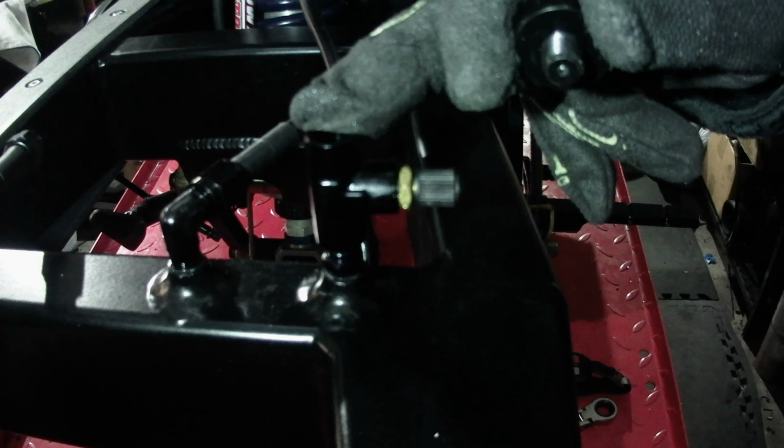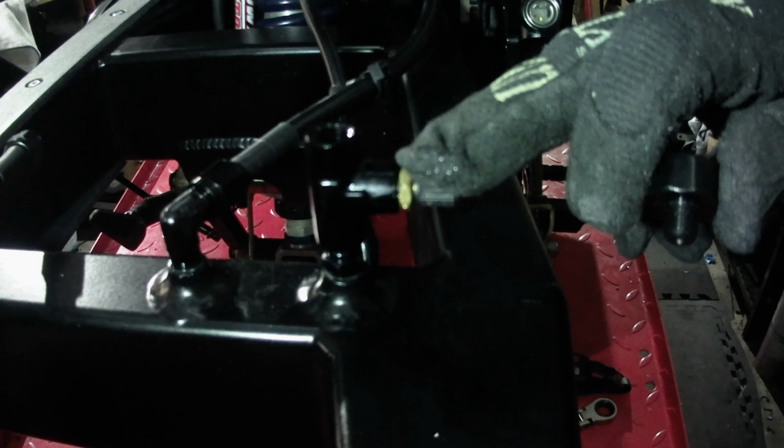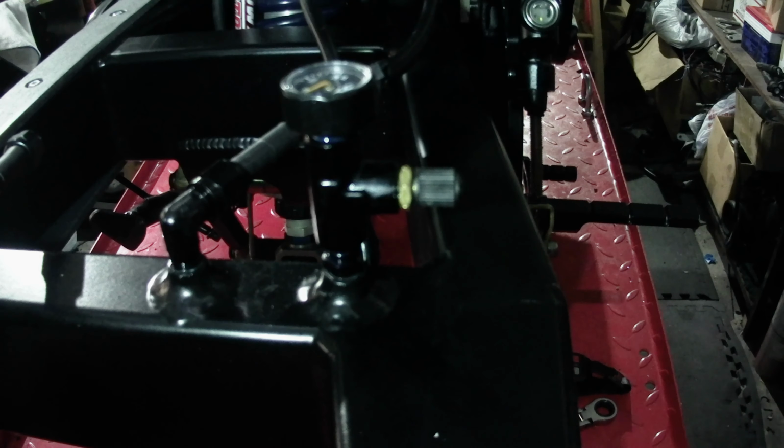Starting with the easy one, I'm going to put the gauge in my T-fitting on the swing arm air tank. A little Schrader fill valve, but little gauge, go in there, bam. A little bit of blue Loctite, and we'll be set. Nice and simple, nice and clean.